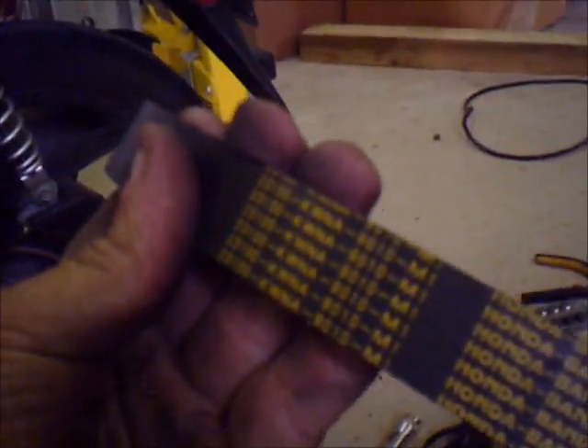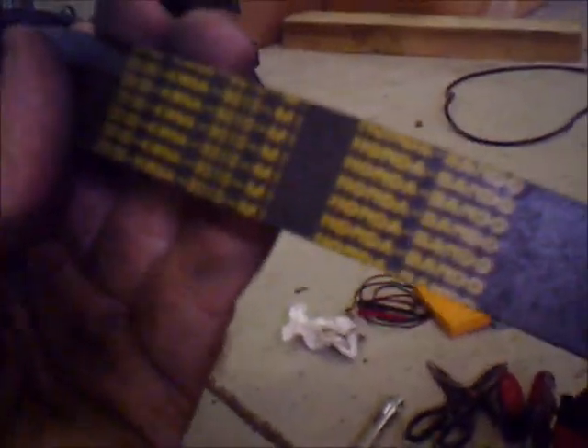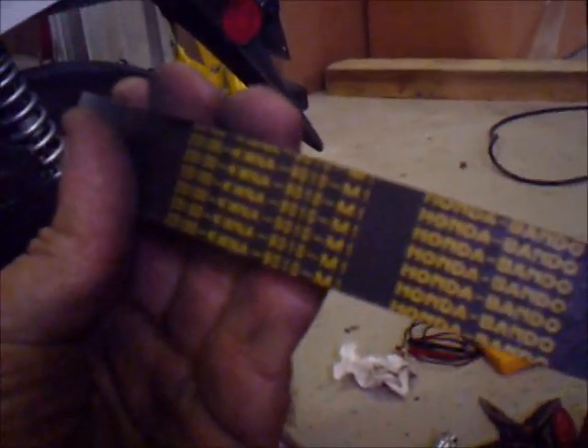Alright, it's time to get that belt and get that thing on there. There's the old belt — notice what it says on it: Honda Bando. I don't know what Bando is, but it's a Honda belt. This one is brand spanking new and it says the same thing. This here is a Honda belt, ladies and gentlemen. Don't go after your Kevlar belts, don't go after your Gates belts, don't go after your aftermarket parts. If it doesn't say Honda, rip it off your bike and get one that says Honda. This one will go the distance — those Kevlar ones will not, they are junk. The Honda brand belts are the way to go.